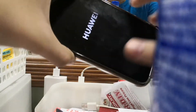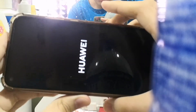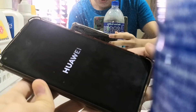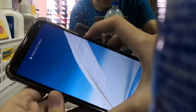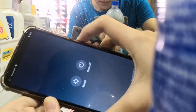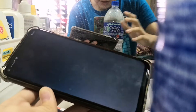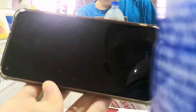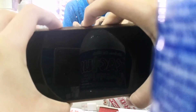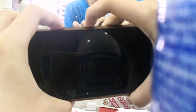Next, let me show you another way to boot into recovery mode. I need to power off the phone — select 'Power off'. For recovery mode you have to do the following steps: keep pressing the volume up and power button together.